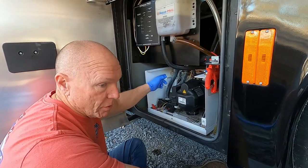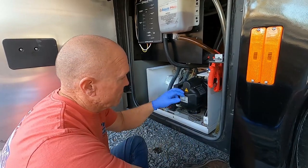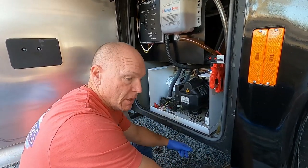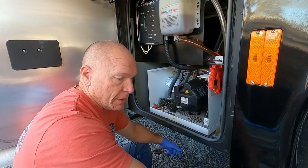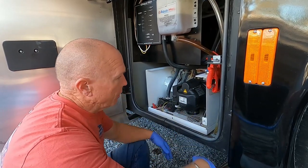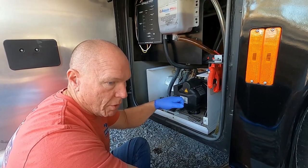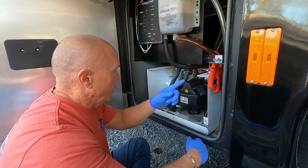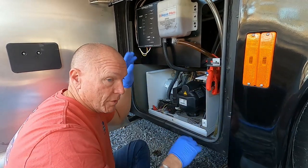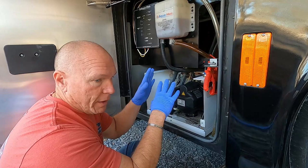The electric element is a lower-grade version — not as powerful as a regular six, ten, or twelve gallon hot water heater. What we have here is like a diesel burner on demand. It heats up the boiler fluid that runs through the system for the hydronic heating in our coach. We have little radiators at different places that are thermostatically controlled — the hot antifreeze goes through those, the fan blows over it, and hot air comes out. It's not forced air, doesn't dry out — it's a pretty good system.